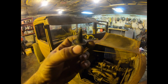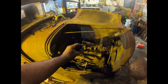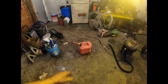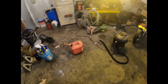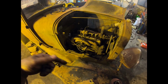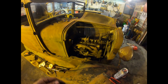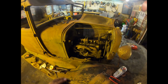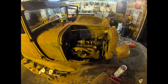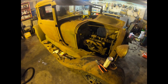I'm going to take this 8090 applicator valve off an 8090 jug, and I'm going to ram it inside this fuel line. I don't have any premium gas here, so I'm going to put 2-year-old 2-cycle fuel in it and fill that carburetor up, see what leaks down there. We'll get a good idea if the carburetor is going to hold fuel or not, and then I'll crank it over. If it actually fires off of it, then we know the main jet's not plugged. We're going to pull that carburetor apart and clean it anyway, but if it fires out of the bowl with 2-stroke, I'd say we're in pretty good shape. So let's put some fuel inside this line and see where it starts leaking out on the bottom end.